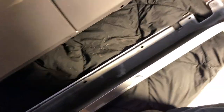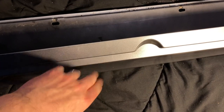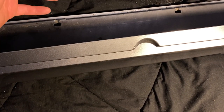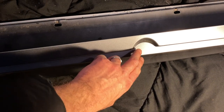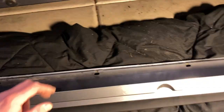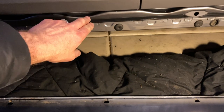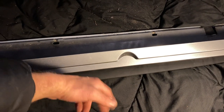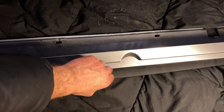It's ready to be installed! I wanted to give you guys a little tip: if you're ever going to install M5 skirts, or even reinstall regular side skirts, make sure to put some masking tape around this area. When you install them, the edges on the doors are very sharp at the bottom and you can scratch this area, so the tape will save your side skirts from getting scratched.